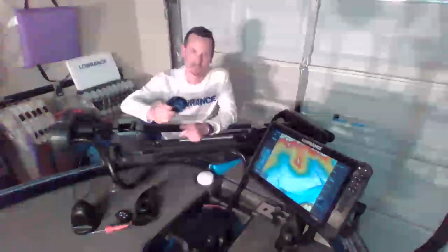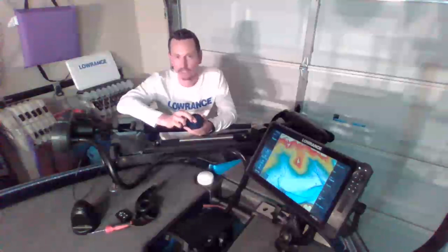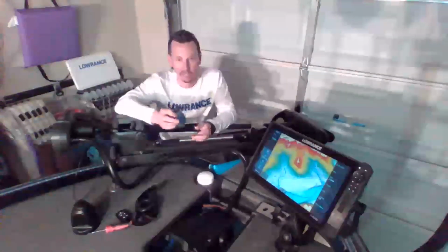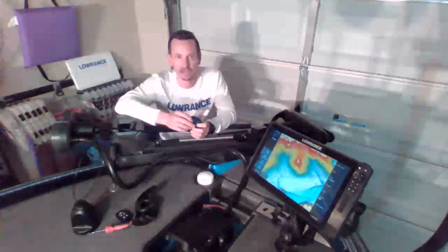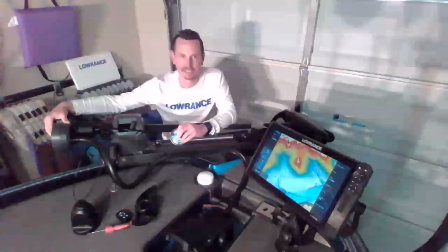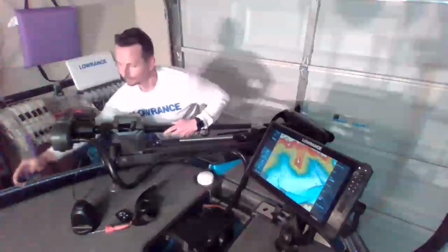By having the magnetic arrow, if you have any issues with it lagging, we do have a new Teflon ring that it rides on. If you call us, we'll get your name and number, or your information, and we can send you that new Teflon ring. You shouldn't need to use anything to lubricate it. But if you do have debris inside here, it's okay to just use hot soapy water to clean that debris off. Then when you're done, you just take the arrow and it snaps back in place nice and easy.